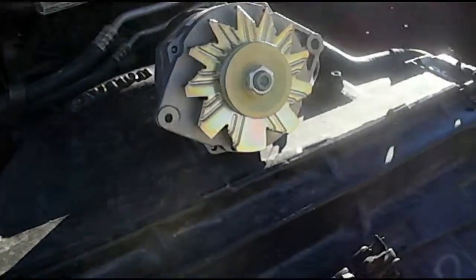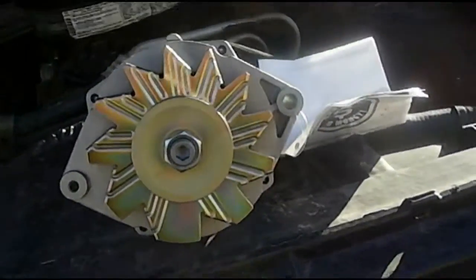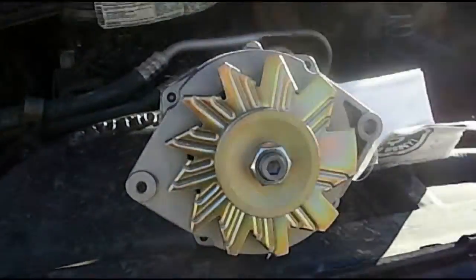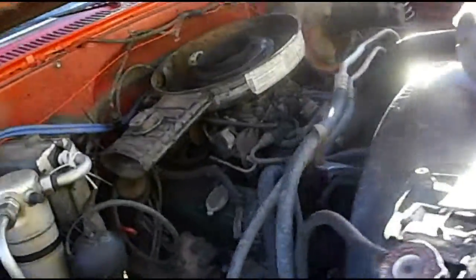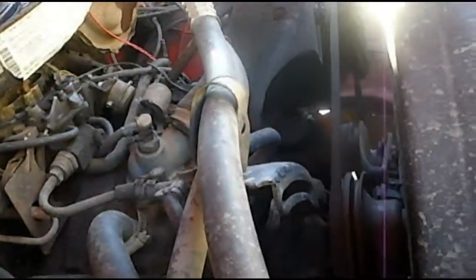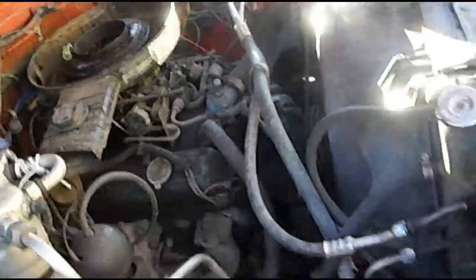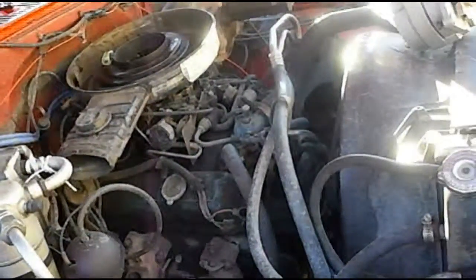When I got the exchange on the alternator that I replaced on the 1st of February, they were quick and easy. Thankfully, the parts store was only about a 5-minute walk. I had reconnected my battery, electrical-taped the connector off, and drove there without an alternator. I still have a belt on my water pump and crank pulley and power steering pump, so no issue driving it to the parts store. It was like a 2-minute drive — made it there just fine, made it back.